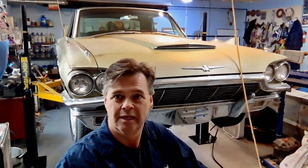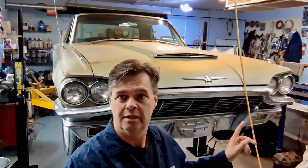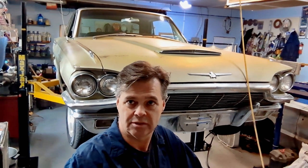Welcome back to James' Repair Shop. Back in the shop again on the '65 hardtop, with the max jack set up and the car sitting up on her. I'm switching the transmission out — the one that came in this car is a C6, which is correct for '66 but not '65. It's also slow going into forward and reverse, so since I have a couple spare Cruise-O-Matics, I'm going to throw one in.